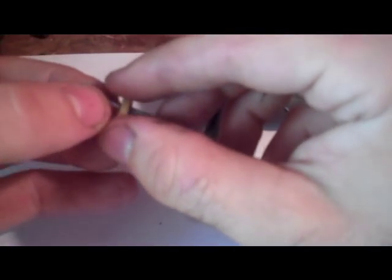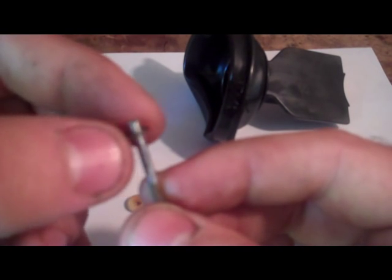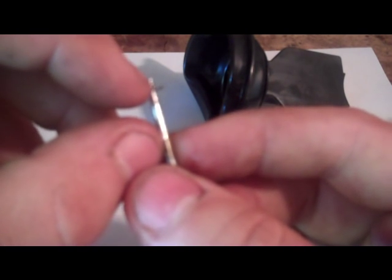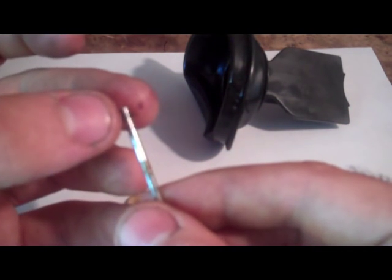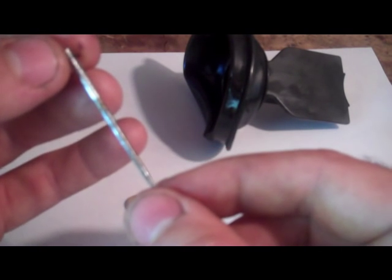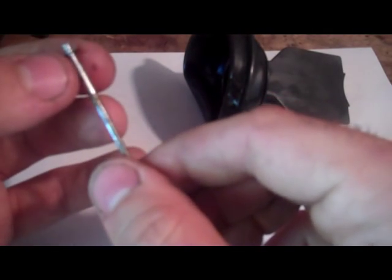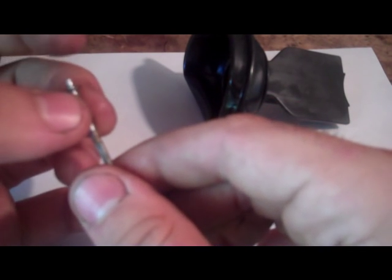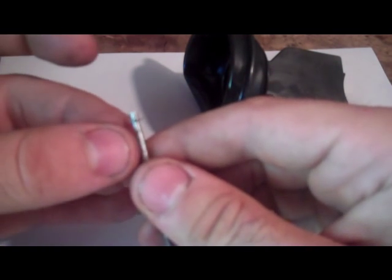So you can go ahead and take out your needle. You're gonna have this little piece right in here that you don't want to lose. And you can see right here, I'm not sure if the camera can pick it up, but there's this little stay right here, and it clips into a number of different grooves that go down here. And so you can move this up and down. If you move it up, think about it now, you're in effect elongating this needle. And so the gas is going to have a little bit of harder time being sucked up into your venturi there, into where your gas and your air mix. And so you're going to lean it out. If you move it down, you're shortening the needle, and so you're going to enrichen it. So basically what this does is it just pops off and pops back on.